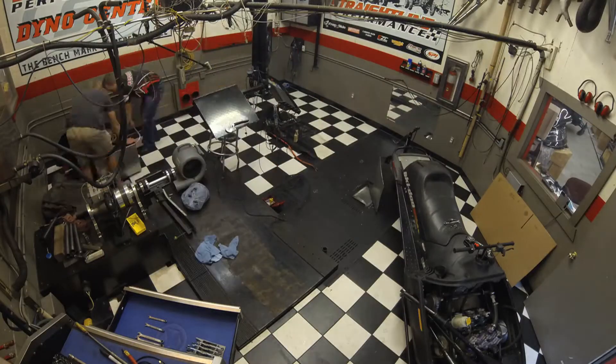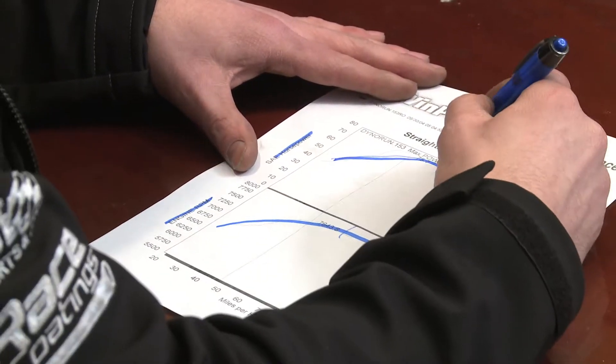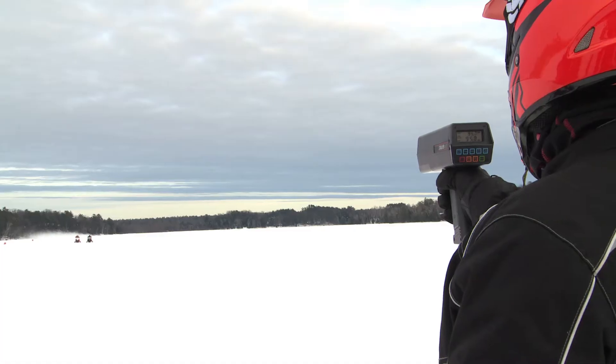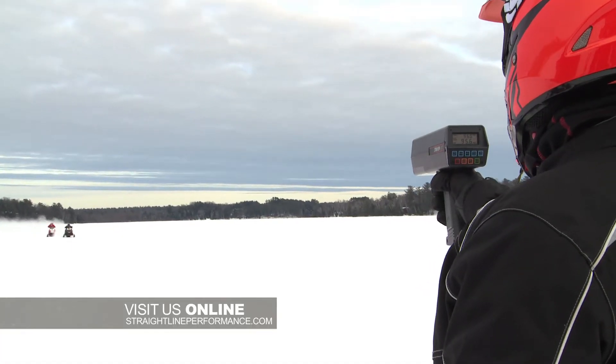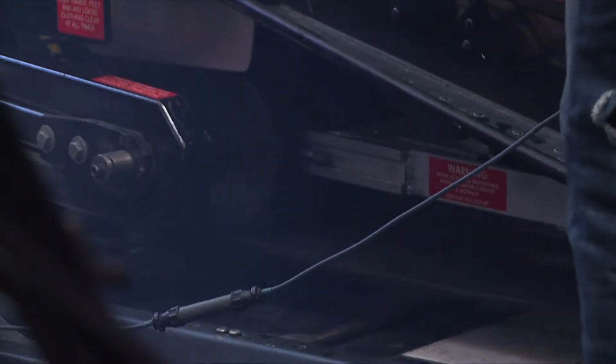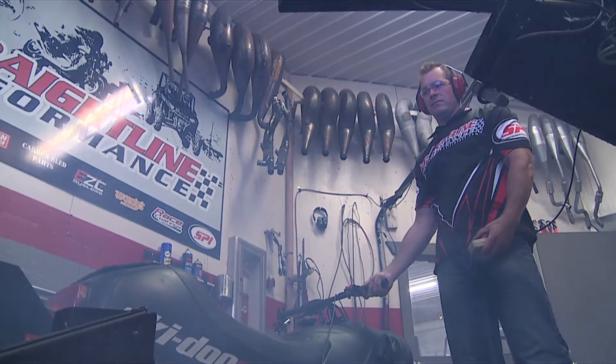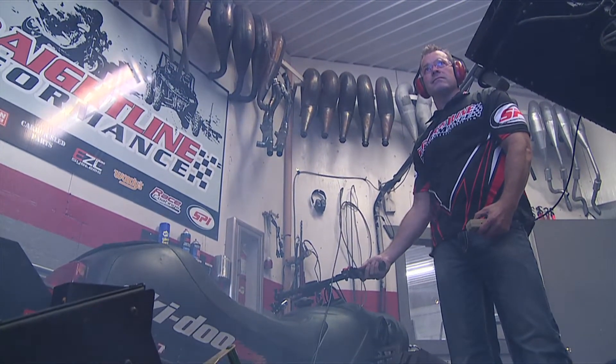The biggest thing we're looking at right now is we want to find out where the peak power is and what the curve looks like to generate the most power. According to this machine, we're looking at 7,900 to 8,000 RPM, all the way out to 100–110 miles an hour. We're going to see some adjustments from the chassis dyno to the field — that's real common. But we know what we want that engine RPM curve to look like in the field. We can try so many options on the chassis dyno that would take months in the field, scaled back down to a couple days of dyno testing, with in-field testing narrowed down.